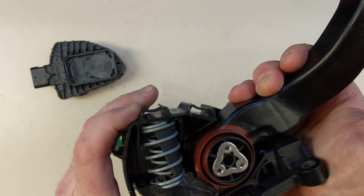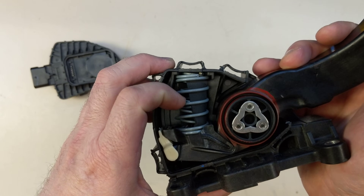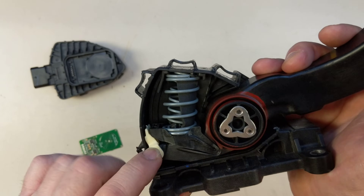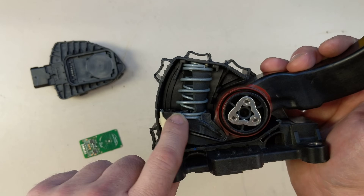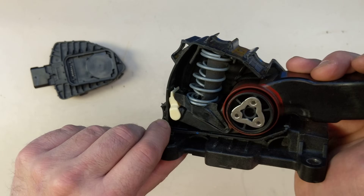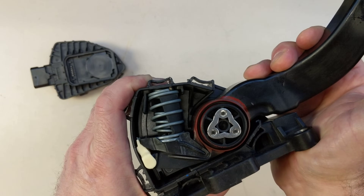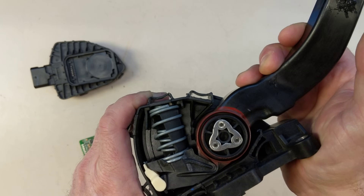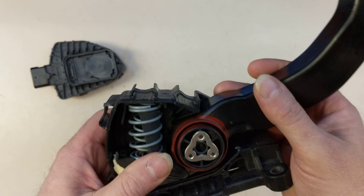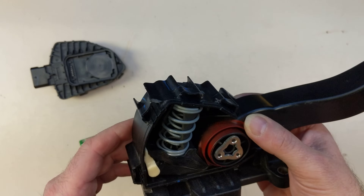There are also two pretty powerful springs in here. To stop the springs from going twang if you drop the pedal, they have a rubber damper in there — you can hear when I flick it, it just goes 'tuk' instead of making a twangy noise. There's another interesting mechanism: the springs are pressing on a cam-like piece that's pushing a piece of nylon into the back wall. This creates some stiction or friction so that when you press the pedal, you feel like you're doing something — it feels substantial. They did a really good job of making this feel like you're actually doing something important, and that's important for the quality feel of the vehicle.